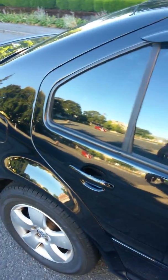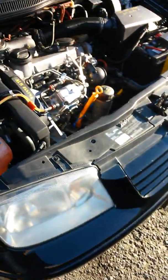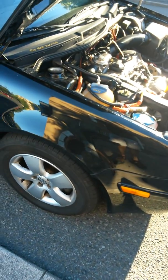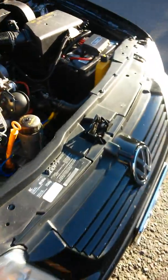This works perfectly — I can load this car up like you would not believe. I used solid bushings just for that reason. I can load the back with camping gear and I have one of those extensions that goes onto the hitch — the square box deals that hold 500 pounds. I can load the back of this car up with a thousand pounds, air up those shocks, and I'm good to go. I'm really glad I did all the rubber in this car — it's snappy. Snappy performance on the steering. No more of that body roll like I had before.